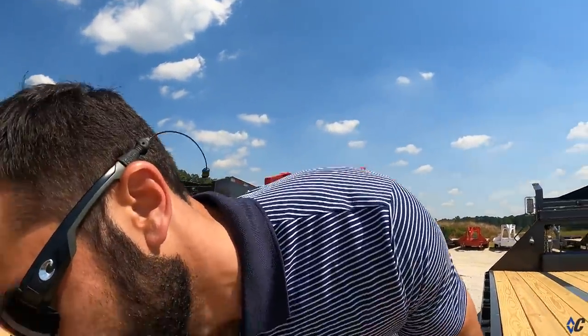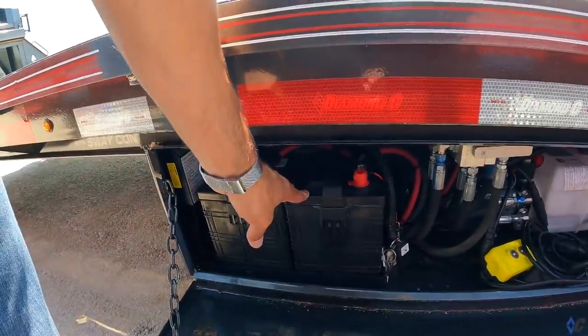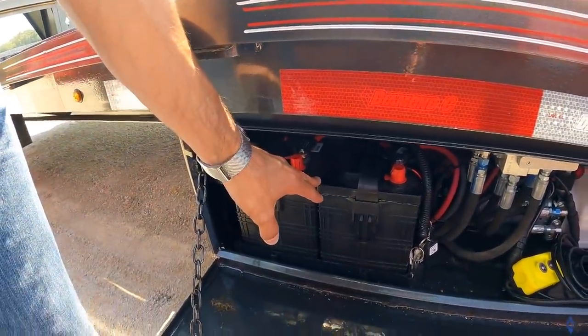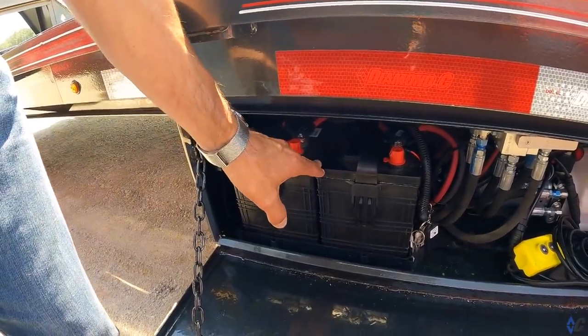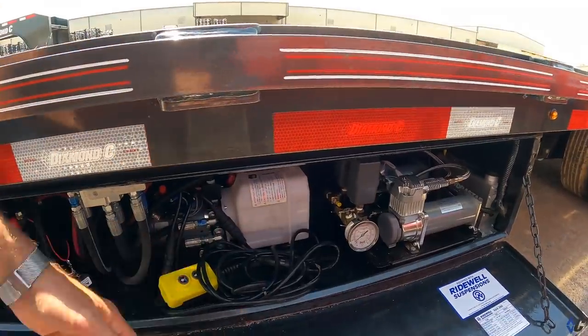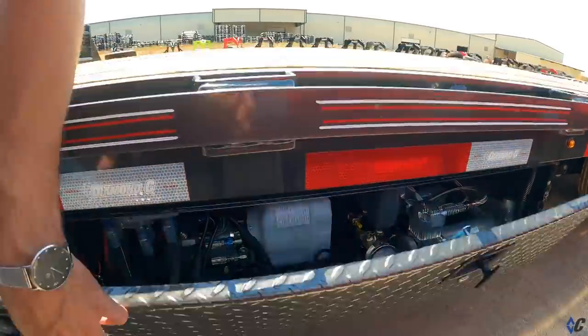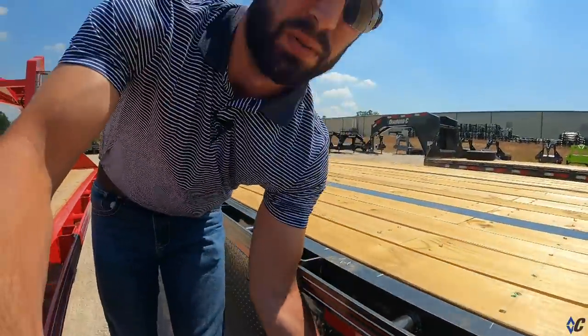The air ride is fabulous. It's obviously an investment up front, but depending on how much your rear is in the seat, it's a great return on investment — your back will definitely thank you. That's a RideWell component kit. Inside this box you have your air controls, all on-board, running off dual batteries. All of our air rides run dual batteries for battery life so you don't run low. There's a pressure gauge, manual dump valve, and a valve stem so if you ever lost power you could manually air up at an air compressor station. Dual quarter-horse compressors fill the bags up, and you don't need air on your truck — it generates its own air, its own little compressor kit.